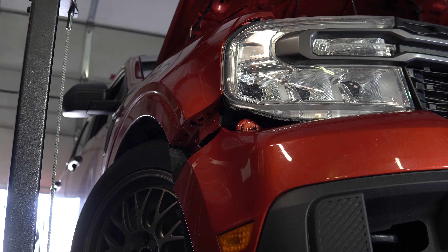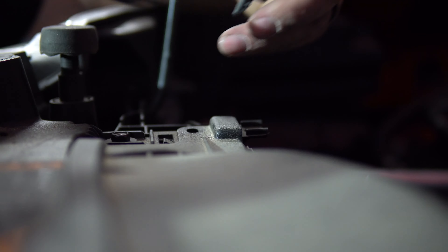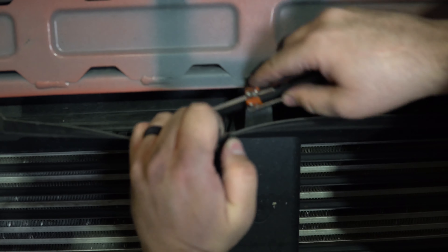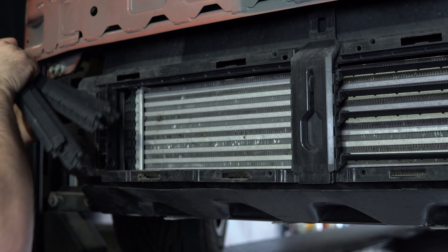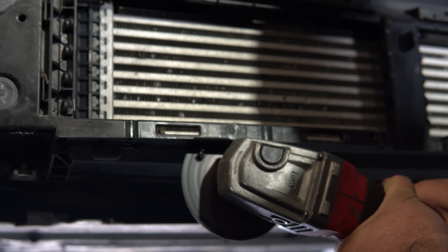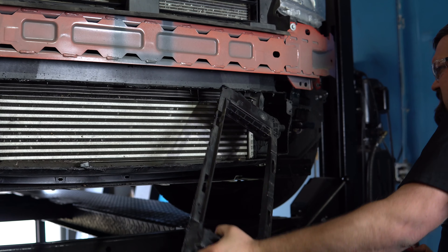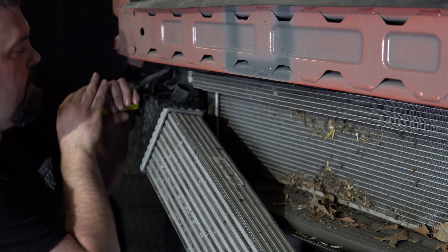You'll need to take off the front bumper by removing the screws and clips on the top and bottom, as well as the clips on the fenders. Once all clips and screws are removed, the bumper will pull right off, exposing the intercooler. Remove the plastic cover and fins to gain access to the intercooler shroud. Trimming of the plastic shroud is required due to the increased size of the CVF intercooler. The intercooler will need to be disconnected from the charge pipes for removal using a flathead screwdriver by pulling up on the clamps to release them.